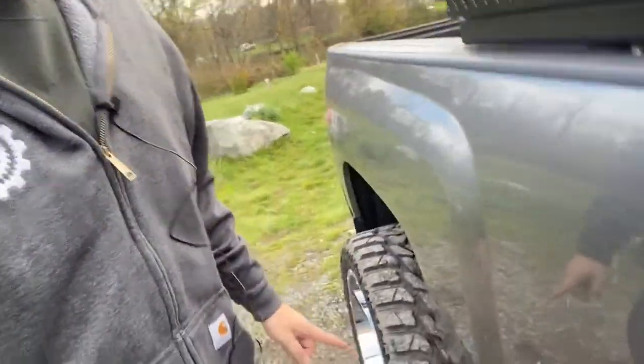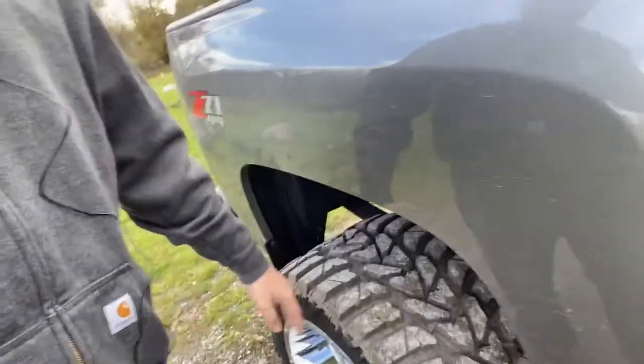With the negative 51 offset, you get a good amount of tire poke. Most 12-wide rims are around negative 47; these ones are negative 51, which — I guess a couple millimeters matter, you guys know that.